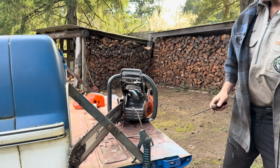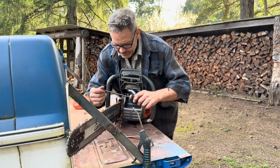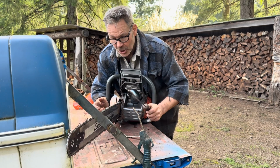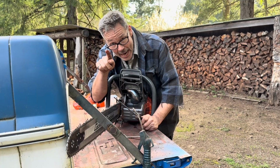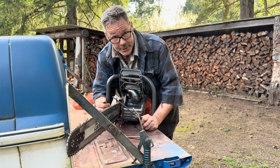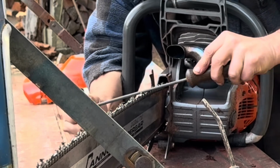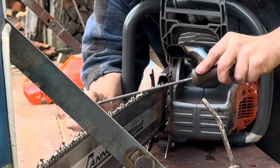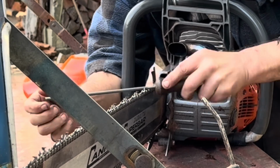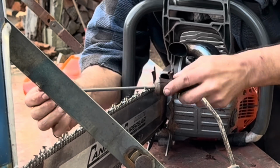So you guys just saw what I did, right? See, here we go again. Remember I showed you the gullet on the side? Take a look at that from the side. See how much material you've got to take out of there. If it's a bunch, do a couple of boat strokes like this, down. There you go. I just wiped the gullet out. Now flatten out. You're not doing that with a file guide, friends. You're just not doing it.